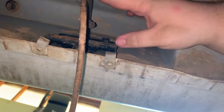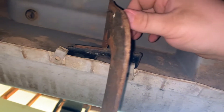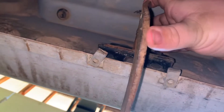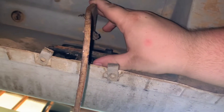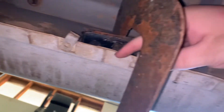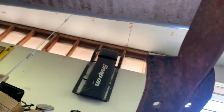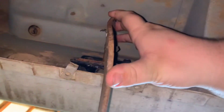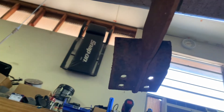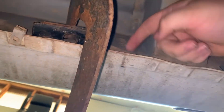For these other guys here, they are also off — probably a half-inch gap or so. They would need to be spaced, and then what we could probably do is just drill new holes in our rocker here, and that should be more than sufficient. I want to get the top mounted before we worry about these bottom mounts, because those should be fairly easy since you can access both sides of this pinch weld.